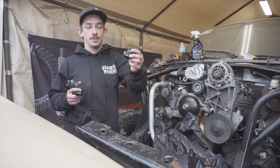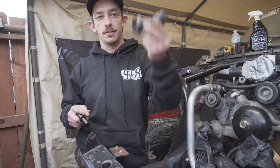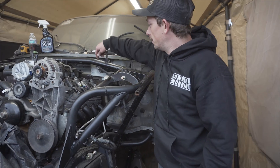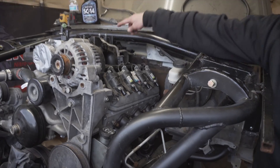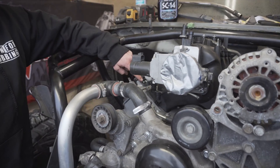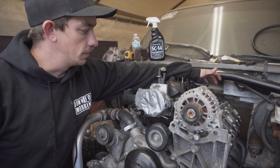Today I'm going to show you guys why I'm using this billet aluminum adapter fitting that goes into the valve cover. This is the stock one — it's trash, we're not going to use this. So over here there is a nipple coming off the valve cover, and it runs up to the PCV valve up here. On the other side you have another fitting here, so this is considered the clean side and this is the dirty side over here.